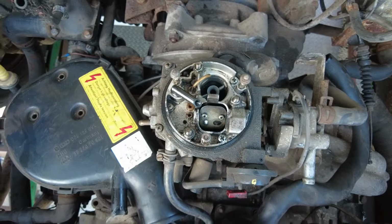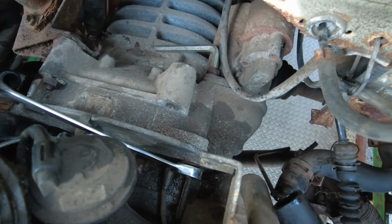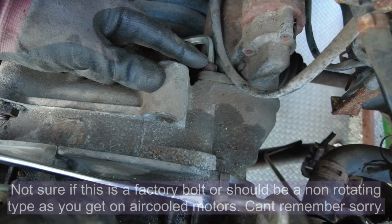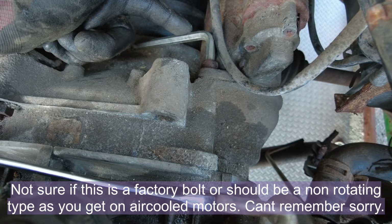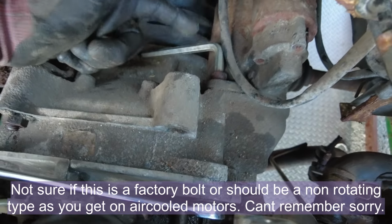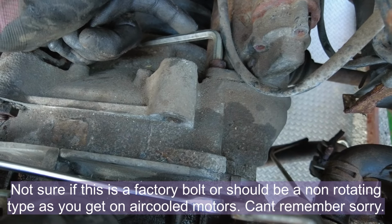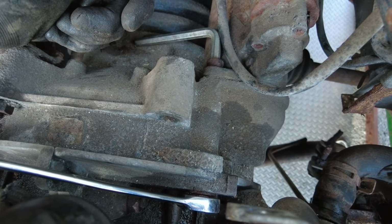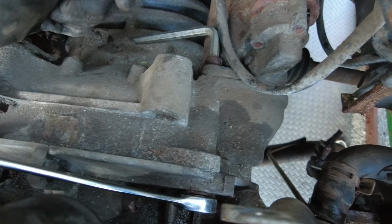get anything in there. So over on the left, the nut came off no problem at all, so got the bolt in there, but it's put more of a fight on this side. So to hold the bolt still on the starter motor side, I've had to use an 8mm Allen key or hexagonal wrench. This is actually an old one from my collection, and it's slightly more than 8mm, and it's still slightly sloppy, so I'm not sure what the actual size should be, or if it's just rusted away or what. But hopefully an 8mm Allen key will do you there. Hold it still.